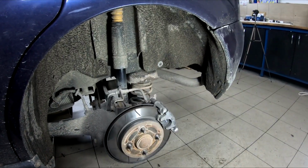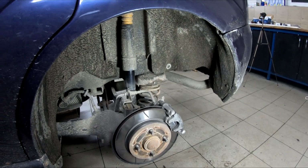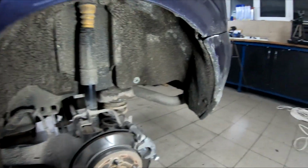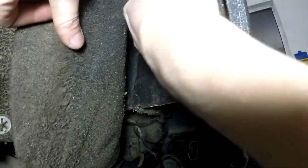So I want to start with the sensors first, after that the speaker, and at the end with the control module. So to put in the sensors we will need to remove the rear bumper, meaning first we need to start with this screw that is a T25 hopefully, and after that you will need to remove another screw that's a 10mm. Actually it's a nut.